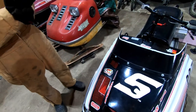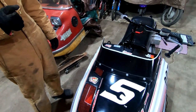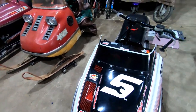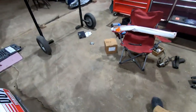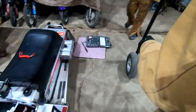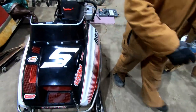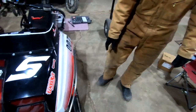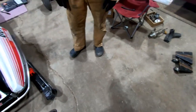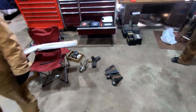Well, the way it did spark, if it lean seized, it would have been tight. Yeah. You didn't stick it. No. It says, is it just gonna wear through the rings like that? Right. And the way I heard it when I was pulling over... The other side looks healthy though. More healthy, 130, 140. Because right away, once it happened, I ran up and got a fresh set of plugs. I think we thought he was out of gas too, because he was kind of low on gas.